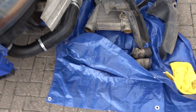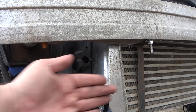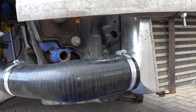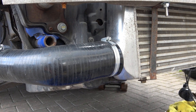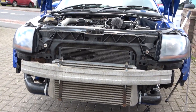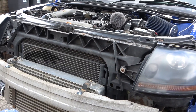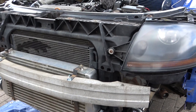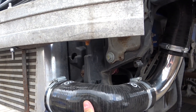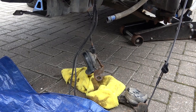I've marked the bumper - I'm going to have to trim just on the inner edge where the plastic grille is pushing against it. I need to trim away some of the lower section otherwise it pushes against the pipe work. It's quite a snug fit and you do need to trim it - I don't think there's anything you can buy off the shelf that fits perfectly without some trimming. They do make a kit with pre-welded metal pipe work which may need less trimming, but we'll still need to trim where it touches the bumper. Once done we'll pop the horns and temperature sensor back in.